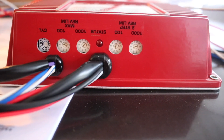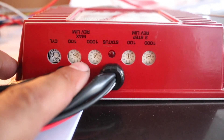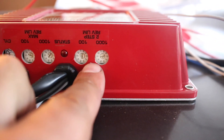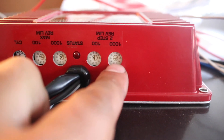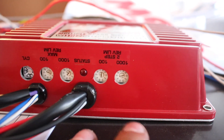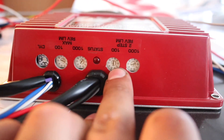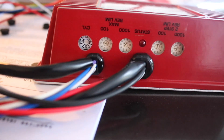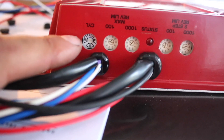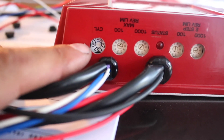Before we install the box, I went ahead and removed the plugs and put in all my settings. We have the cylinder setting at 8. I have the rev limiter set the same as in the Holley Terminator — 6,800 RPM, which we should never get to. The two-step is set at 2,500 for now. For the rev limiter, same dial principle: thousands of RPM and hundreds of RPM. For the cylinder selection, you can do 4, 6, or 8. The middle of the selector is shaped like an arrow but it's all white, so shine a light in there to make sure you have the right one selected.